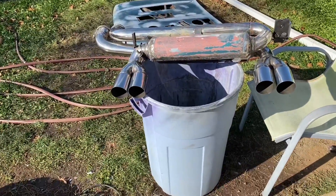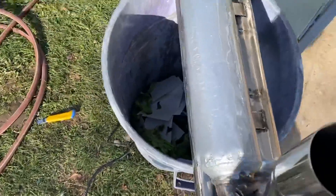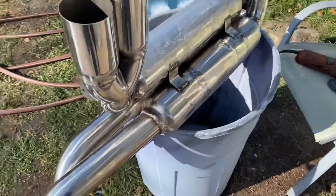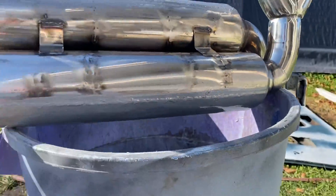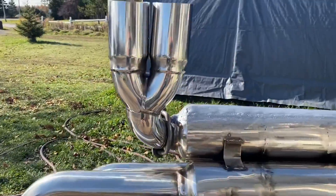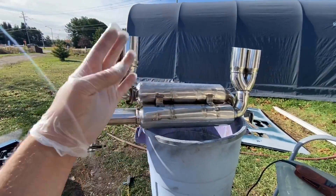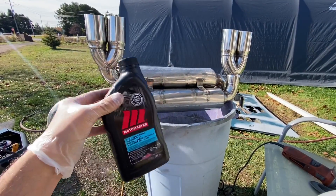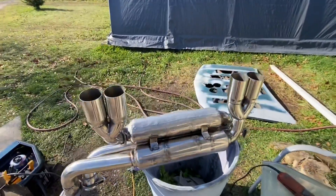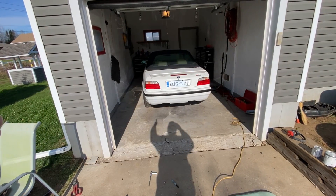There it is — all visible parts look nice, painted and cleaned up. The welds aren't super perfect but you don't see most of it. Now this is two-stroke engine oil, like for dirt bikes. I'm going to dump about 200 milliliters into each one and then move the whole thing around so it gets to everything. The oil inside will sizzle around as the car runs and that will prevent it from rusting. Once the paint dries we're putting it on and I will show you a before and after — stay tuned.